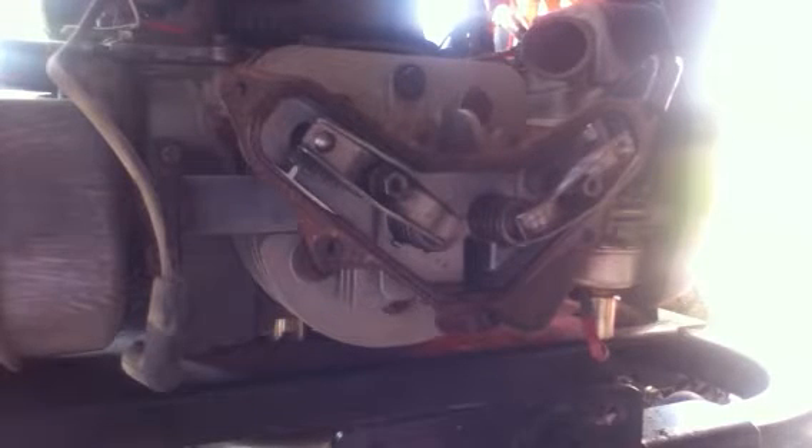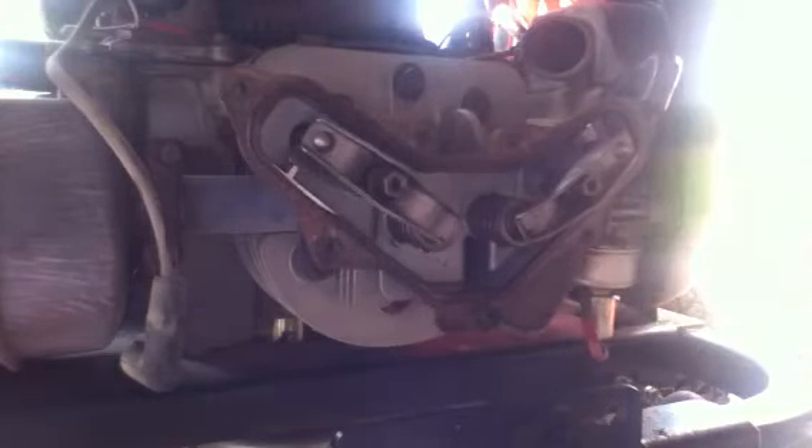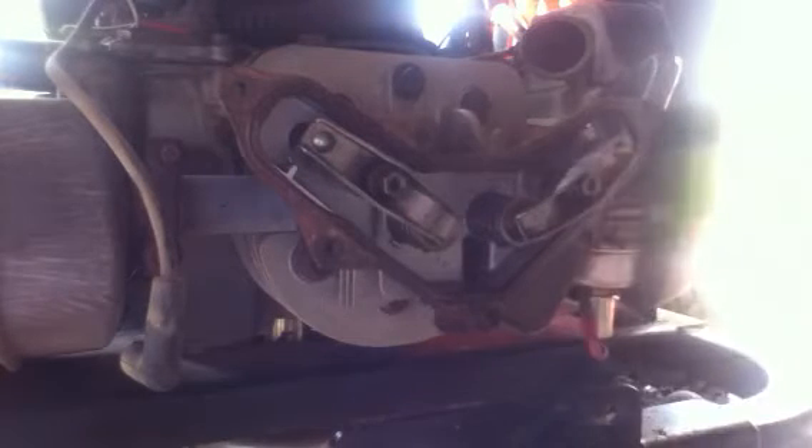As promised, I'll make a valve adjustment video. You would have started by removing your cover on the back. We're using a feeler gauge — this is a 0.007, which is what you want for this kind of mower. But look up the specs for your lawn mower engine; they're all different. Just Google your model number and type in 'valve adjustment' and you'll usually find something.